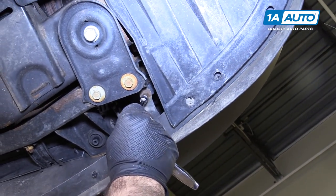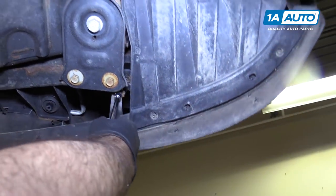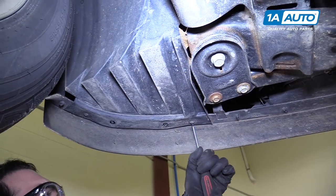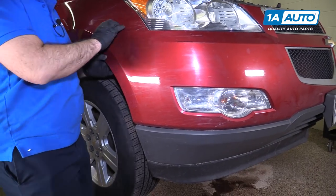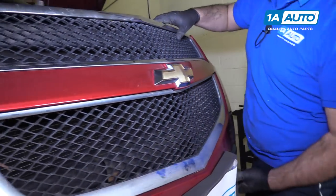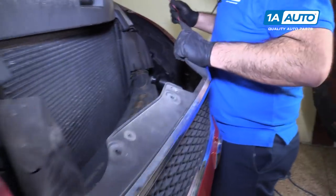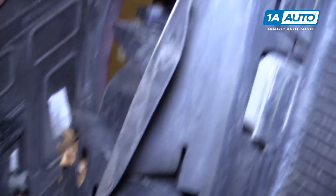There are 10mm bolts on each side — this little bracket is holding the front bumper on. Remove both of those. This bracket was already broken, but you can take this bolt out. Do the same for the other side. The bumper clips into brackets, so I'm just going to pull on it and pull it out of the clips. Sometimes you have to give it a good tug. Support the bumper and pull it away from the vehicle. There are fog lights or front marker lights — I'm going to unplug those. Do the same for both sides. We'll put our bumper aside.